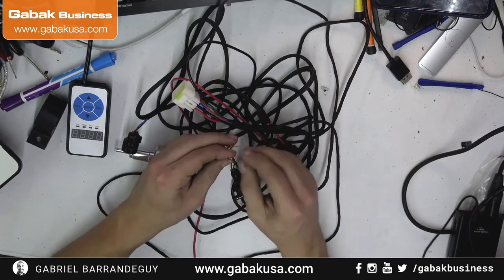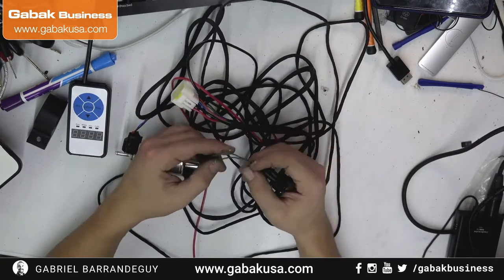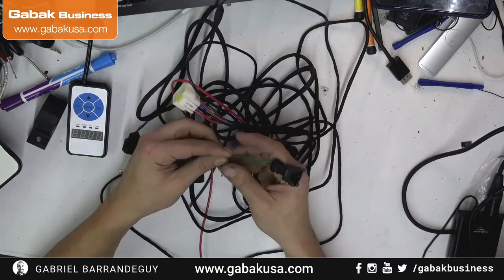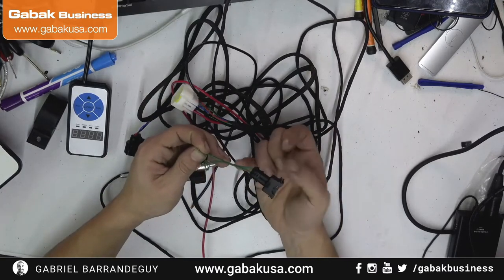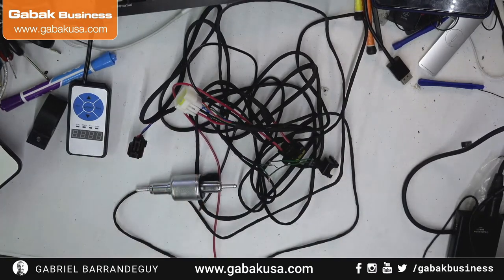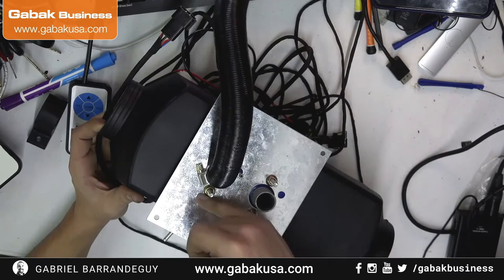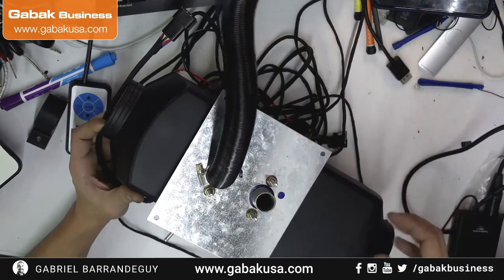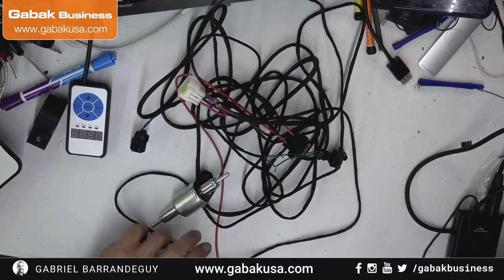One mistake I made: after finishing the installation, I started smelling fumes inside. I traced it back to the small hole I made for the cable — just pinky-sized but enough for fumes to enter. I filled it with silicone, and also put silicone all around the floor plate. That solved all my problems — no more fumes, everything works great.